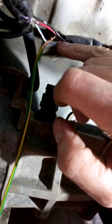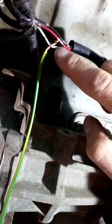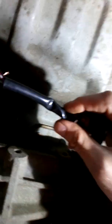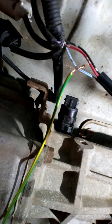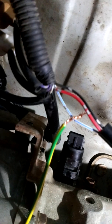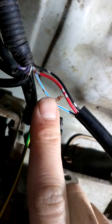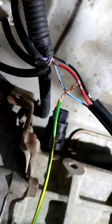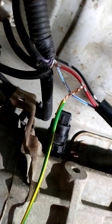On my car, I found there must be a break in the signal wire. So I've cut a bit of the outer sheathing off just to get access to the wire, snipped it a bit shorter, slid it back, and pulled the casing back on the signal wire — which is your white and blue. I twisted a long piece of cable onto it and ran it to the cab. Using my multimeter I tested for continuity and found there was no continuity on the signal wire, so there must be a break in the loom. All you do is twist a bit of wire onto the signal wire and run it all the way to the clocks.